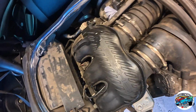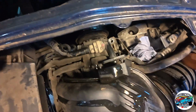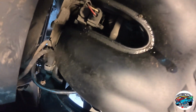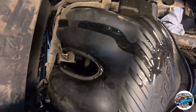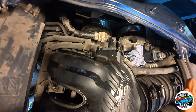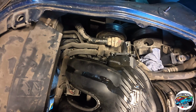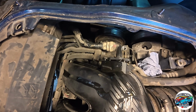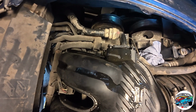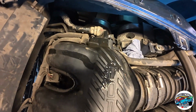And the next step I started to remove is the air conditioning compressor. So one bolt there, which would just come straight out. The other one's hidden down there, so unfortunately you can't see, but that's out. And then what I've got to do is move it back in towards the engine bay that way and just rest it on the back, and then when the engine lowers, you can feed it back through and it comes out with the engine. But you don't need to lose any air conditioning gas if there's any in there. I don't think there is, to be honest. But anyway, that's a good way of doing it, so you don't have to recharge your system. So let's get that moved forward, and then we'll move on to the next steps.